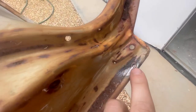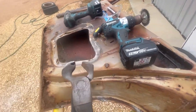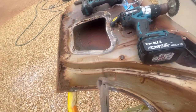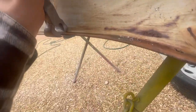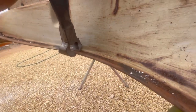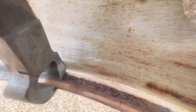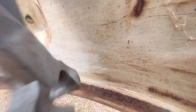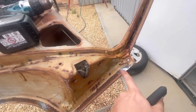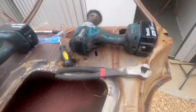The 3/16" is drilled through the spot weld. I forgot one of my most important tools - these nail pliers I've chopped and modified a little bit. There's a little slot cut on this side - depending on the thickness of the skin, that'll just clamp in there, then you give them a little squeeze. The one on the inside is starting to come under the skin, getting that started. Then I'll alternate between the screwdriver and this little fella just to get that lip lifted up to 90 degrees.